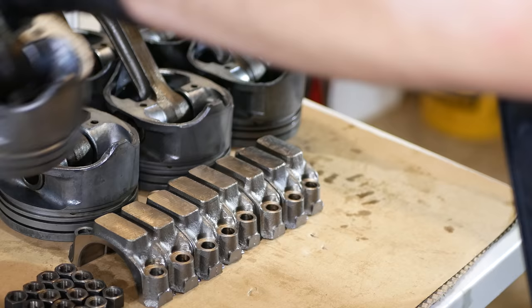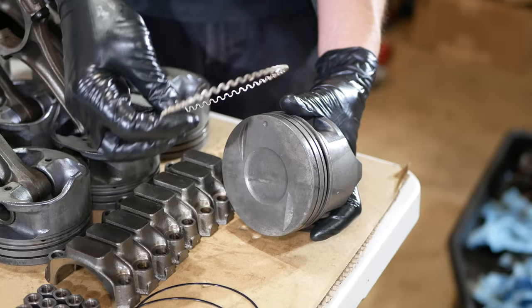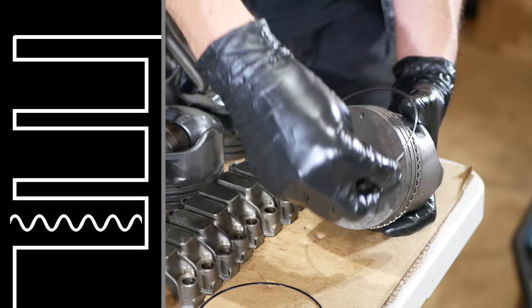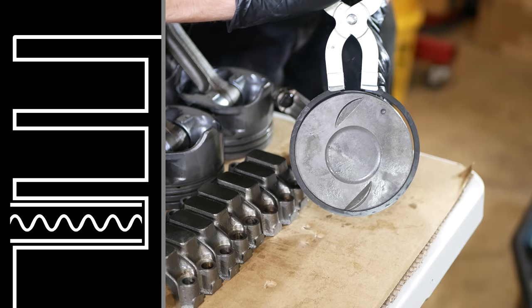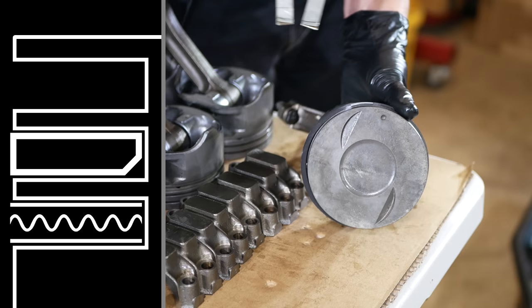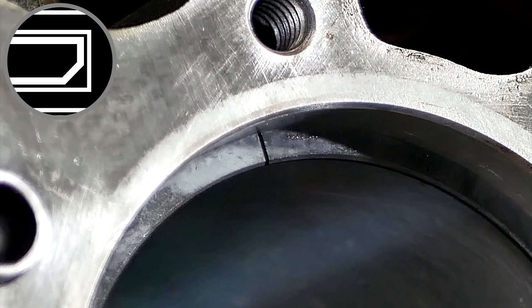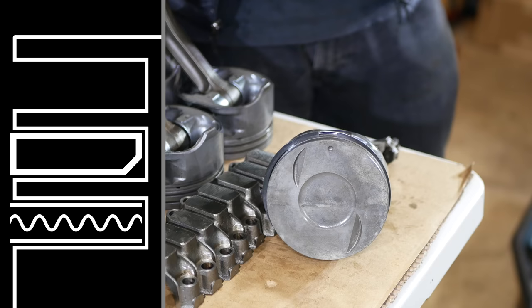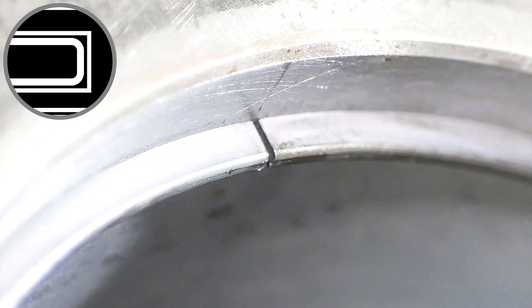Now that those measurements are taken and I'm fully ready to ignore the ramifications of them, it's time to install these new rings onto our pistons. First up is the wavy oil control expander ring, which can be easily spread over the top of the piston and slid into its groove. Then on either side of that go the two oil control wiper rings — these are very thin and easy to spiral onto the piston by hand. The compression rings are much thicker and harder to work with, so we will be using the ring expander to drop the second lower compression ring into place. Most of the time rings that are supposed to be installed in a specific orientation have a marker; in this case the lower rings did not, but they had a clear bevel on one side, and typically that will face down in the second ring position. It always pays to check with your specific piston ring manufacturer because different companies do things differently. The top ring goes on after that and it does not appear to have a specific install orientation — the inside corners are rounded on both sides of the ring.